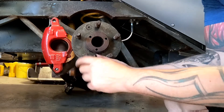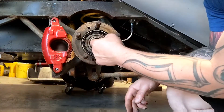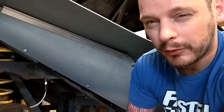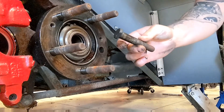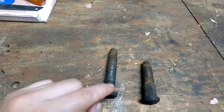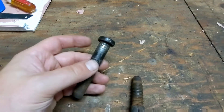Those are surprisingly loose — I kind of expected these were going to be a problem to get out. Good news: this axle seal looks good. As you can see, it's a good thing I wouldn't make any assumptions. Look at the back — something is ground down. Maybe they come like that, maybe they didn't grind it. The knurled area here is completely worn out; that's why those ones just flew out of the back. When I get the new ones, I'll make sure they're nice and tight.